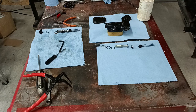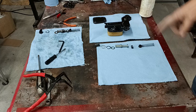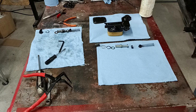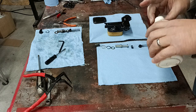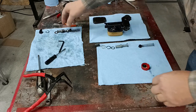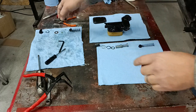Okay, we're back. We've got the master cylinder cleaned up, we've got all the parts laid out, and some clean brake fluid to use to lubricate the rubber parts as we put them in the master cylinder. One thing to watch out for that caught me off guard: on these old Yamahas they use DOT 3 brake fluid instead of DOT 4 like the Hondas of the same era, so watch out for that. We need to lubricate these rubber parts. If you look at this rubber plunger here and you look at the old one, you'll see how it's oriented — make sure you put it the same way.